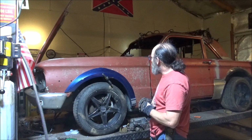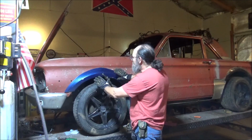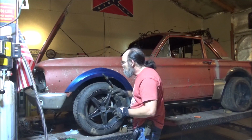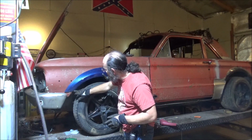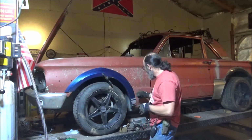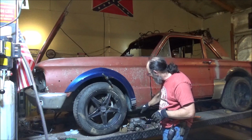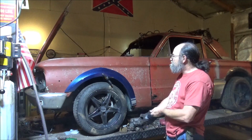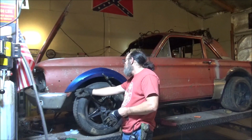Now what I need to do is come in here, look at the black line, and you can cut a lot of this out. Like I said, I don't want to stick down like I'm going to drive the truck. So we're going to have to do some trimming here. Get this to line back up with the original fender. Let me go ahead and cut this off and go ahead and cut this piece here because I want to keep this swoop body line back here at the back.